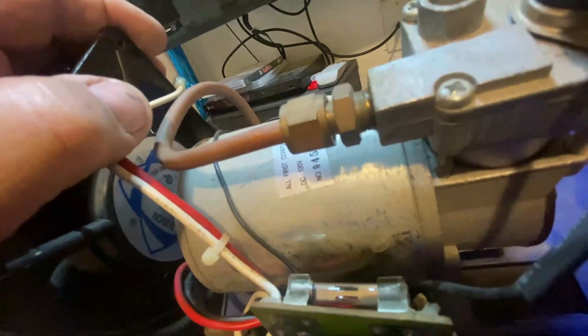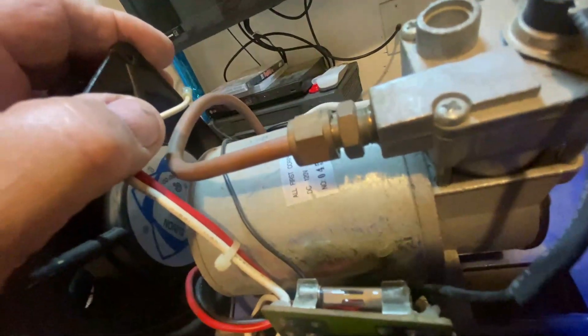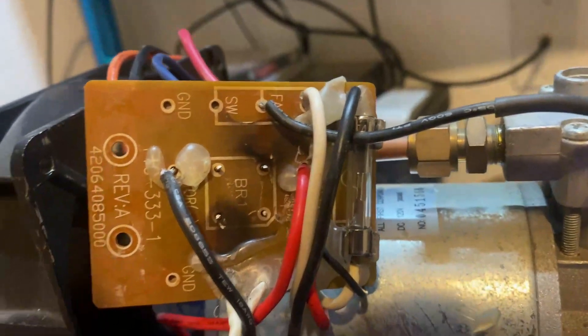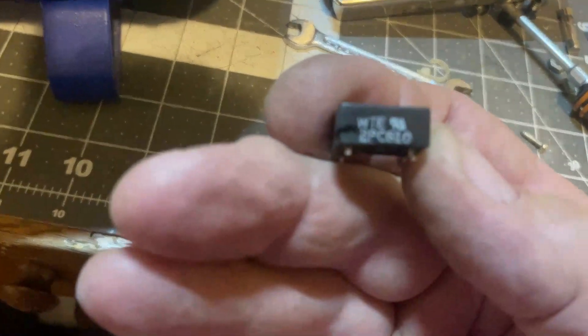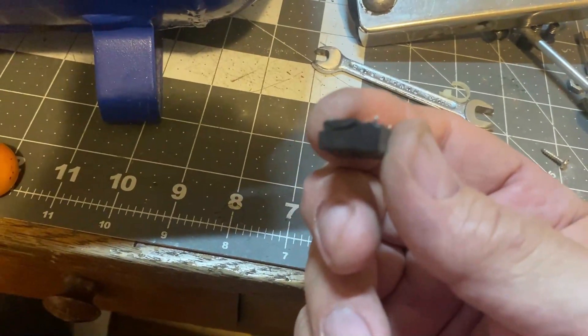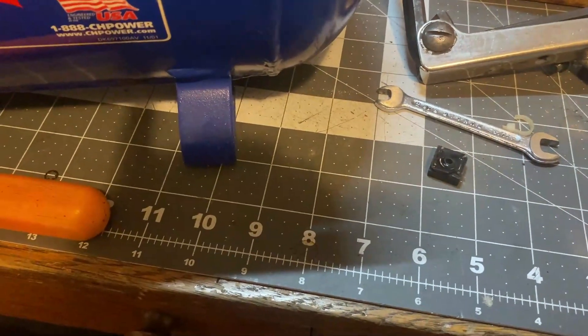I took the cover off and did a little exploring, and I saw that that was a DC 120-volt motor, so I thought this thing is converting AC to DC, and I was going to look a little further into that circuit board. Right there on that circuit board you can see the dark spots, and what goes in there is this little bridge rectifier. You can see that it's cracked, and when it blew, it was shorted out and it was actually blowing the fuse.